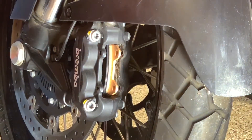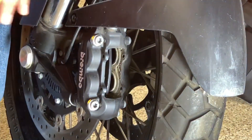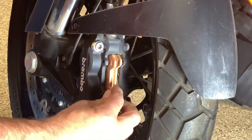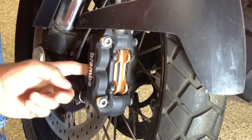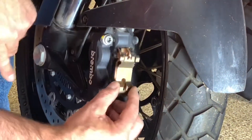Pull your brake pads out. If it's really dirty in there, you're going to want to clean it out — mine were pretty clean. So I just slid the new pads back in about where they need to be. If you push them in too far, you can just reach in behind the caliper and lift them back out. Put my cover back on, arrow pointing up.